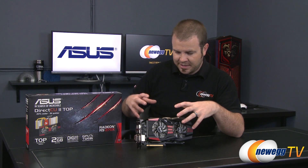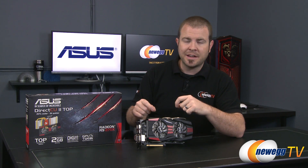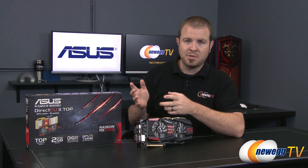In closing, a couple more specs: 2 GB of memory at 5,600 megahertz with a 256-bit memory interface — very nice to have. The Super Alloy Power is an eight-phase power delivery system — six phases for the GPU and two for the memory. That wraps it up for this video. We've been taking a closer look at the ASUS R9 270X by AMD. I'm Paul with Newegg TV. Find more videos on our Newegg TV YouTube channel, check out our other channels like Lifestyle and Newegg Arcade, and leave a comment. See you next time.